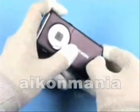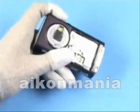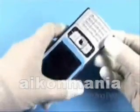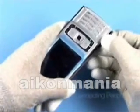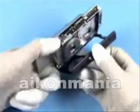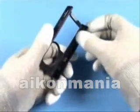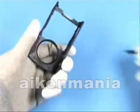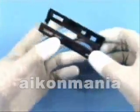Unlock and remove the battery cover. Shift open the assembly. Bend open the back cover assembly carefully. The removal of the SD card door becomes easy now. Keep all 6 adhesives of the back cover clean, otherwise you have to change them before reassembly.